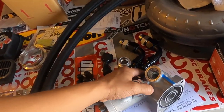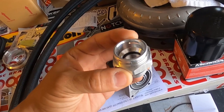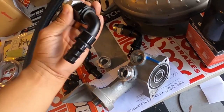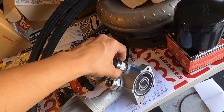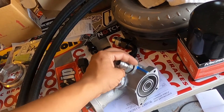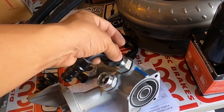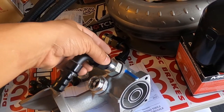The other big thing is cooling — we're running an oil cooler. I had to go to our local fitting store to find something that'll work. The stock style is a flare-in pipe, but they don't sell that aftermarket — it's a factory thing only. So what I ended up doing is getting these o-ring style dash-12 fittings. The dash-12 will take its place. It is kind of bulky but I think we should have enough room. We'll tighten it up before we put it on the car, and then you'll have your dash-12 AN push lock with two lines running parallel up to the oil cooler.